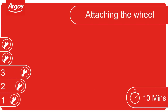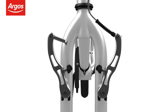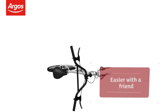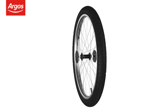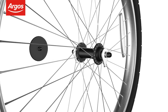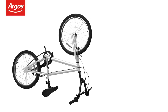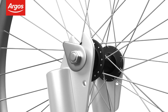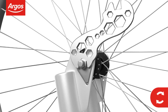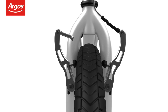Attaching the wheel. Located on the front forks, unclip the guide pipe noodle from the V-brake assembly. Fitting the front wheel is easier with the cycle upside down. Some assistance may be required. Firstly, remove the axle protector caps by pulling them off, not turning them. This will prevent the wheel nut from getting stuck in the cap. When ready, insert the wheel so the axle is located at the base of the forks. Now that the wheel is in place, insert the tab of the wheel retention washer into the receptacle on the forks on both sides. Tighten the outer wheel nut with the spanner provided. To finish attaching the wheel, reattach the guide pipe noodle and rotate the bike upright.